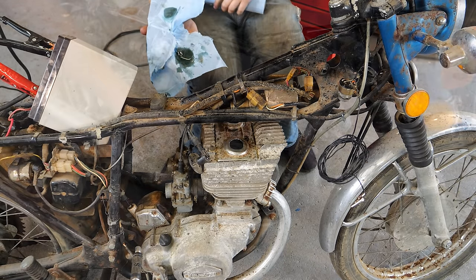All right, she's all synced up. I've got the same amount of turns here as I do here. Let's see how much better it runs. Oh, no. It actually is idling. Much better return. I thought I might have had them set a little low, but it seems to be idling just fine.